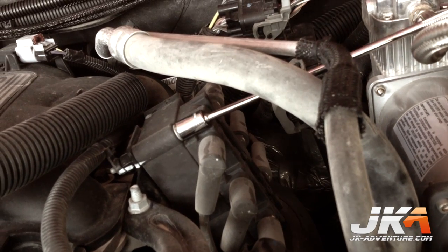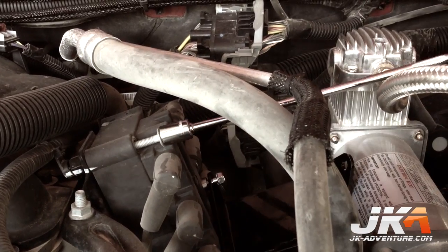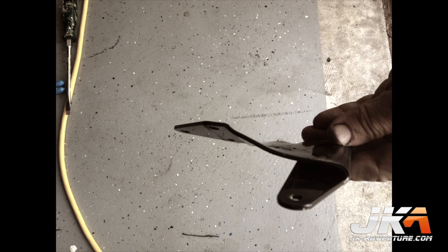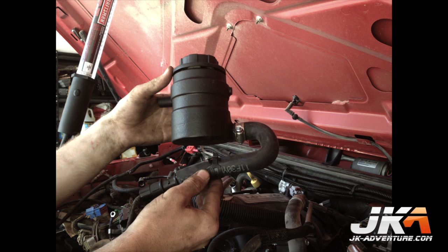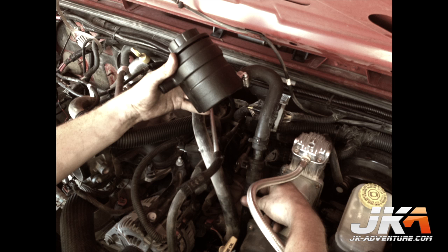Remove the bolts from the coil mounting bracket on the driver's side, then use the provided bolts and spacers to install the reservoir mounting bracket over the coil pack. It may be necessary to modify the reservoir bracket to relocate the reservoir closer to the coil pack depending on your compressor location. Prior to mounting the reservoir on the bracket, install the hose first: cut the short leg of the supplied J-hose to one-and-a-half inches and connect it to the rear reservoir hose barb. Cut the other end of the hose to seven inches. This short hose connects to the hose just connected to the pump using the provided hose mender and two spring clamps.